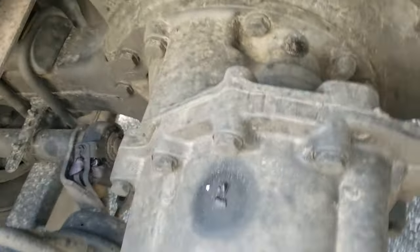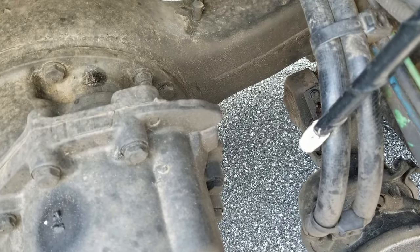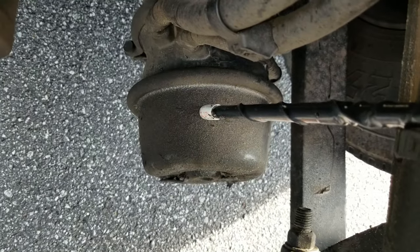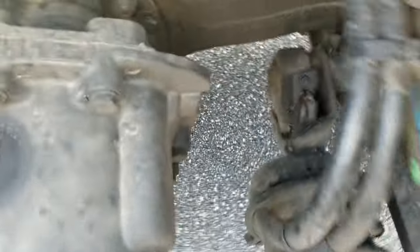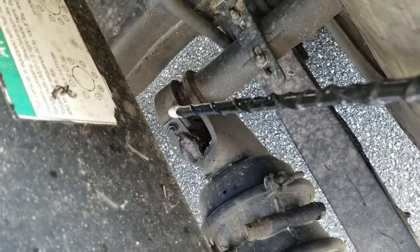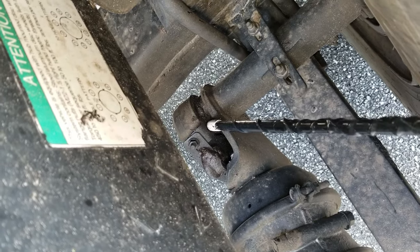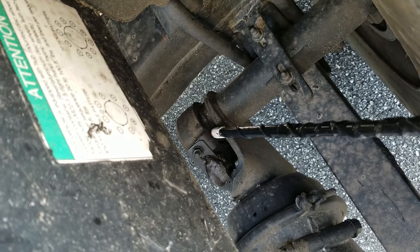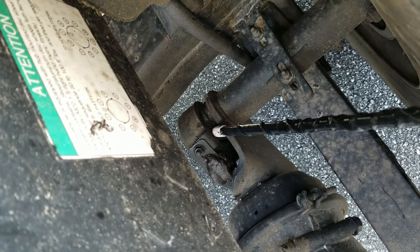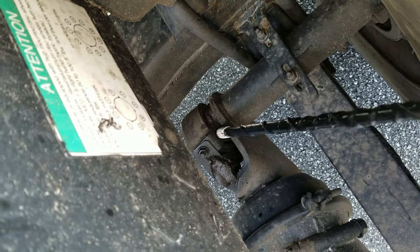Checking my braking system. The first thing I want to check are my air lines, make sure they're not cut, frayed or dry rotted, no signs of leaks. I want to check my brake chamber to make sure that it is securely mounted, no loose or missing bolts, and it is not cracked or dented. I want to check my slack adjuster and push rod to make sure that the push rod is not bent or damaged, the slack adjuster has no loose or missing parts. With the brakes released, the slack adjuster should not pull more than one inch; one to two needs to be adjusted, anything over two, out of service.